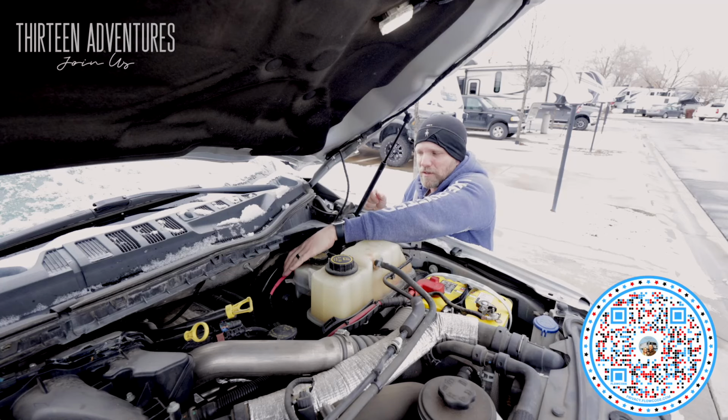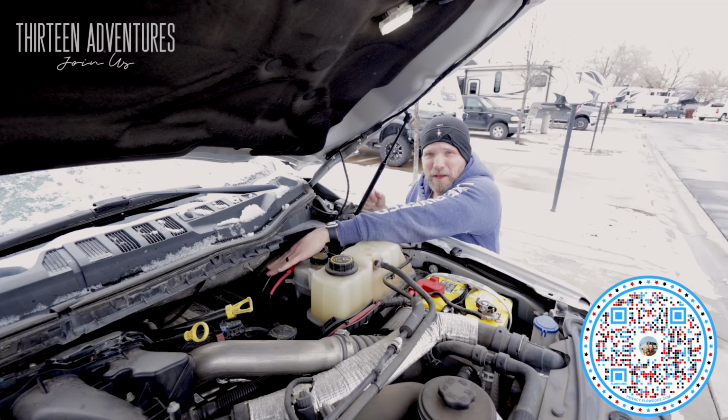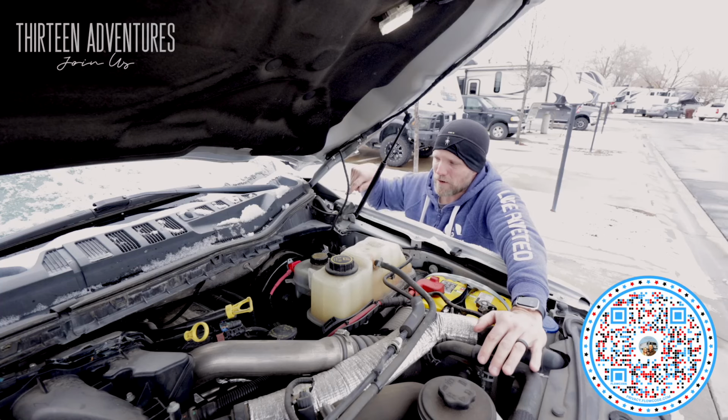And then I have my fuse double-sided taped here to the brake. So this is the master brake cylinder right here, behind here, and your brake fluid. But I have it double-sided taped right there so it doesn't get hot. It's not on the firewall. It's not next to any exhaust, and that wire runs all the way back.